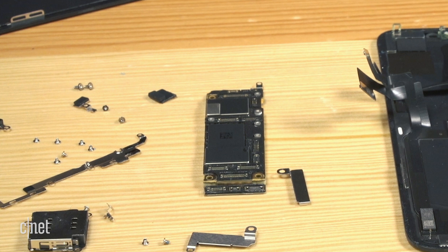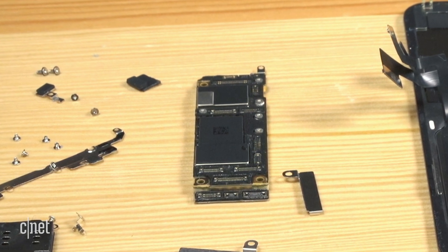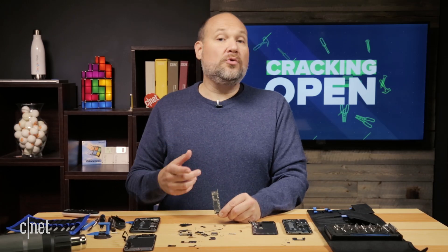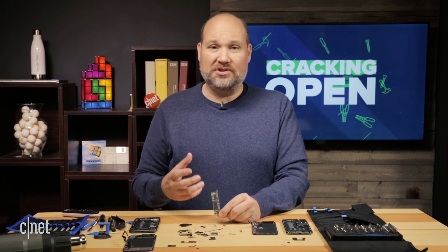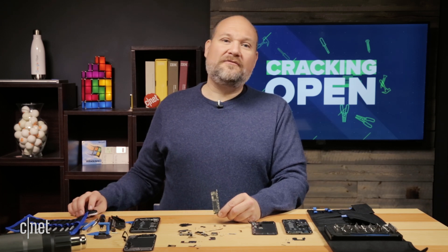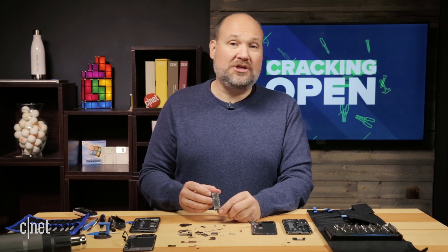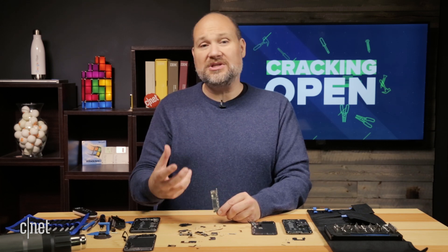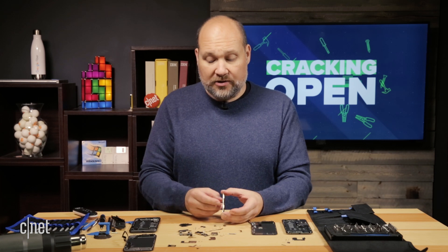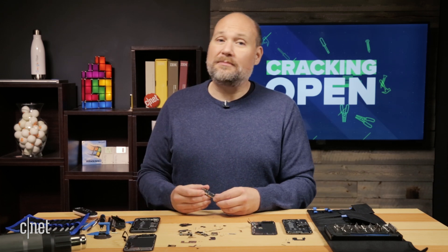This is a stacked logic board, and both phones have a stacked logic board. On the board, we have Apple's A13 Bionic — their system on a chip — along with a RAM chip, flash storage, audio codec, power management ICs, Apple's new U1 ultra-wideband spatial awareness chip that helps it orient itself in relationship to other Apple devices, and of course all the wireless chips. Unfortunately, in previous iPhones before Apple went to this stacked design, I could remove metal shielding and give you a look at the silicon, but with these stacked designs, trying to separate the two layers would most likely damage it. So I want to put this phone back together and see if I can get the camera working again.